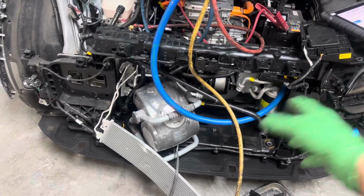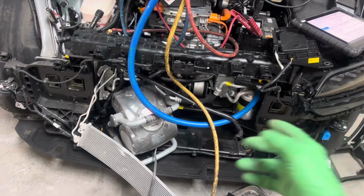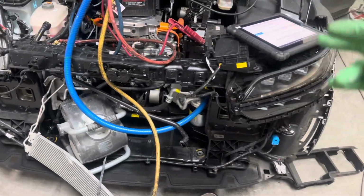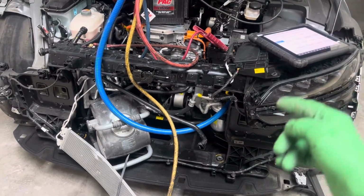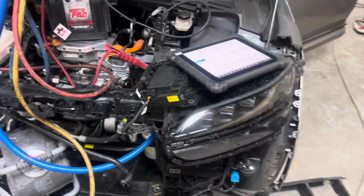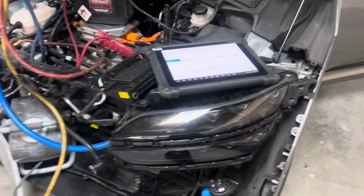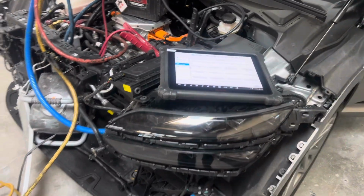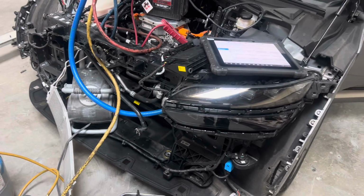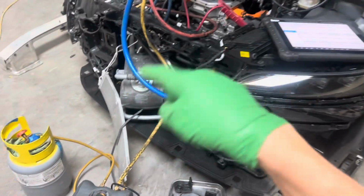Recovery in a shop: it comes in smashed, it can't run, you can't generate heat, you can't get heat guns down to these things. You will be recovering refrigerant in a cold shop that's like 45 degrees. It'll be on the recovery unit for 2.5 hours, just recovery. That's not even including the recharge process. So heat pump systems, a minimum of 2 to 2.5 hours charge on labor for recharge, and extended recovery times.